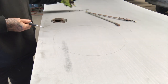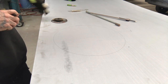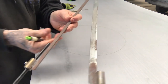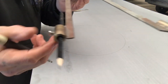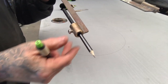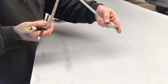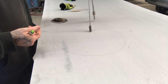For doing bigger things or more specific things where you need to measure down to the millimetre, I just made up this bodgy compass. It's got a nutsert for the pivot so you can tighten it up, just made out of bits of flat bar. I machined up this bit of stainless just to have a point on it, and there's another bit of drilled-out stainless with a bolt threaded into it to hold the pencil. I use this for doing the sides of wheel tubs — you set it at whatever width you need and draw it out the same way as the air cleaner.